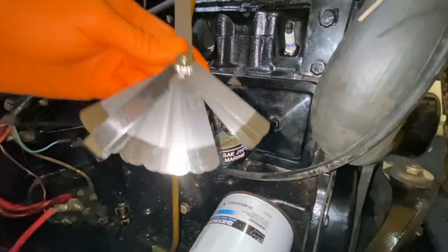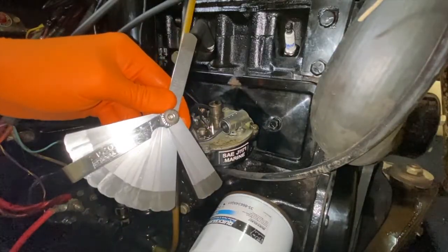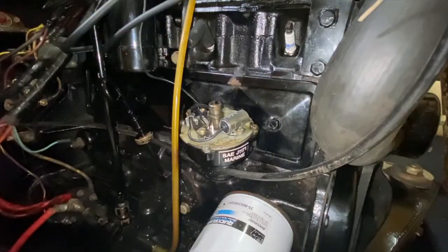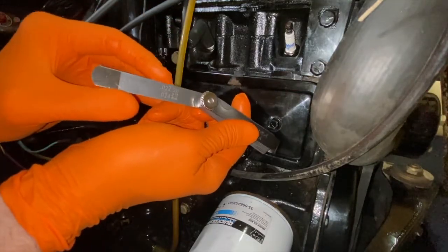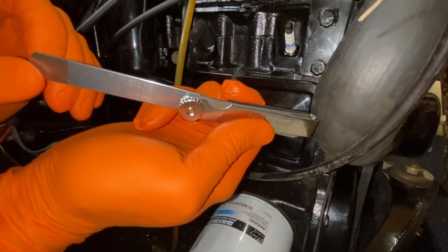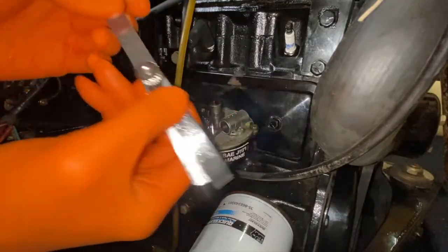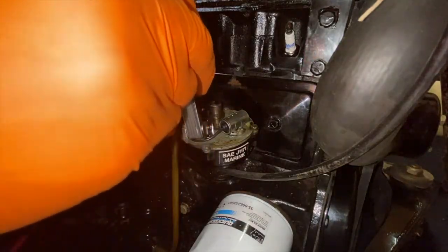I do want to show you the tool. This is what's called a point gap feeler tool, and it's a must. Down below in the comment section as well as the description section will be a link on where to purchase this. Referencing our exact engine placard, we saw that we have a 0.022 point gap. So we are going to start with the 0.022, which is the very tip. As this part feeds up to the circular hinge portion, it gets larger and makes its way to 0.024. We are basically going to insert it inside the little gap here.